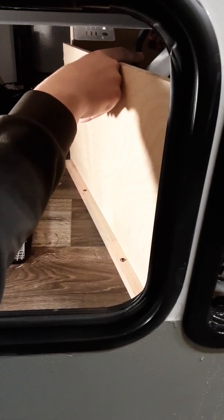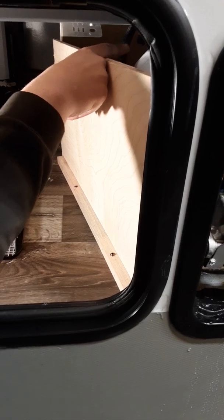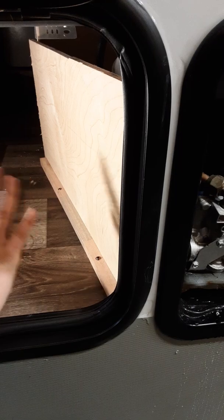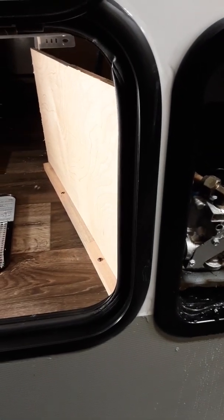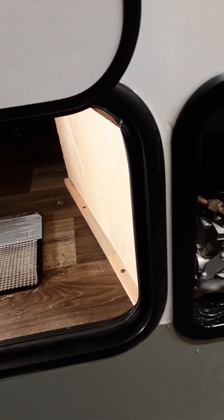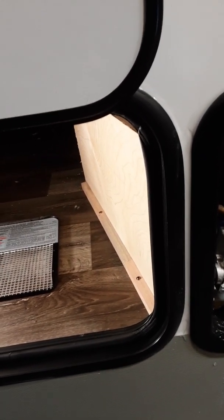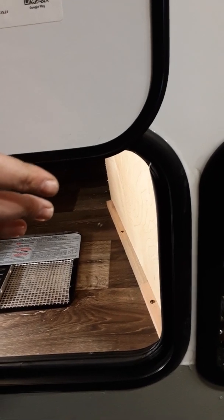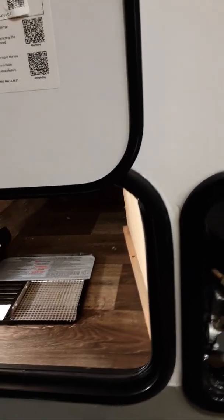Basically, right now, if you look in here, these two screws pop out. That's gonna bring you behind your water heater. Right now it's in non-bypass. So if you hook up water, you have water going to the hot water tank. There's a bypass mode where you can go behind it, and there's levers to turn, and that'll turn it into bypass mode, so you can hook up city water but not have the hot water tank going. Why would somebody do that?